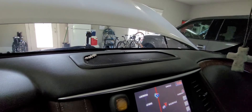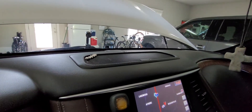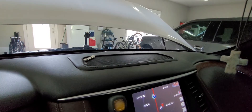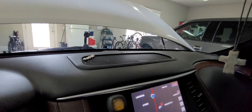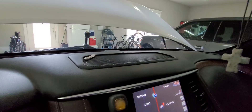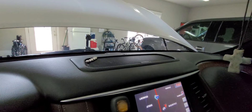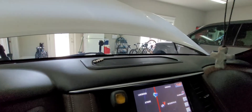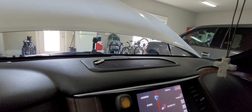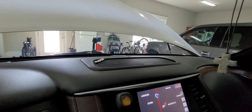Now earlier, before I started this video, I had gotten lucky and saw the problem: I was holding down the start button, I saw my light light up, but I had no crank. As long as I kept my finger on the start button the light stayed lit — the IPDM held that signal the whole time and the engine wasn't cranking. So that's how you figure out: is my IPDM giving the signal, or is my starter motor bad? In this case I've obviously got a bad starter motor since I saw it not work. Hope that helps — bye now.